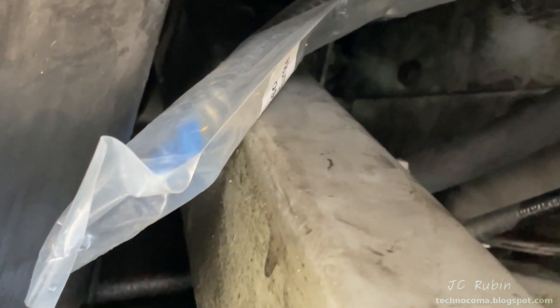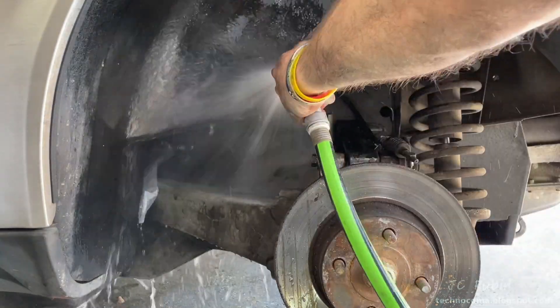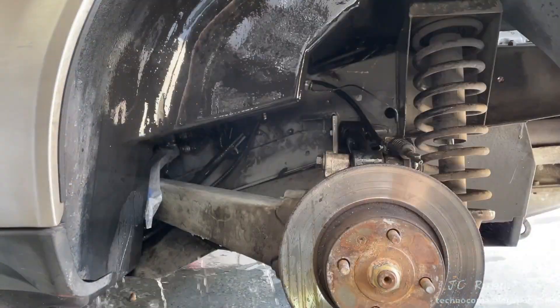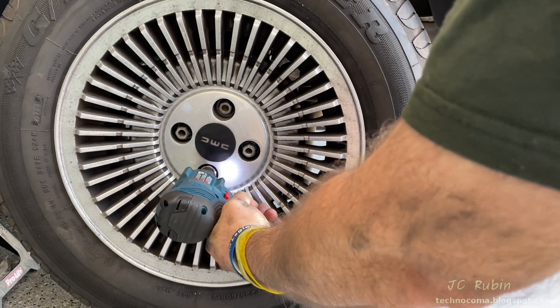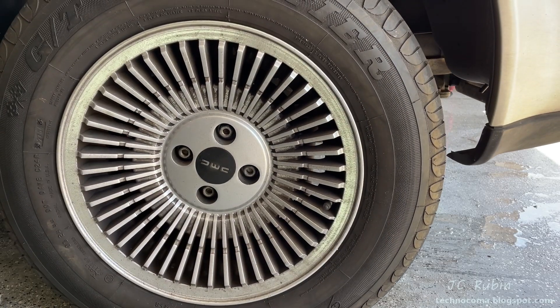I place the bag back on the new hose and spray the entire area with detergent. After giving the affected areas a gentle scrub, I wash the entire area down to make sure brake fluid is removed — there was a lot of penetrating oil too so I wash away everything. I don't leave the car up on the jack for no reason, so until I'm ready to put everything back in, I put the tire back on and lower the wheel back down.